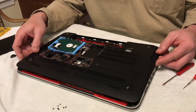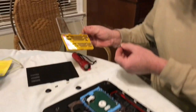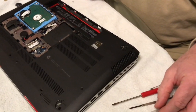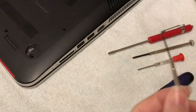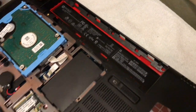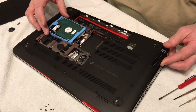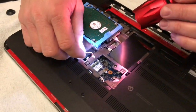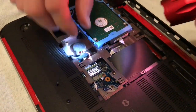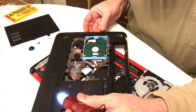We finally got this thing where it will separate. We had to go back to the hardware store and get a set of real small screwdrivers — like for eyeglasses — and ended up having to use one of the smallest straight blades to back out all the little screws around the battery. We finally got that loose. Now we're trying to see if we can move this thing without unplugging the hard drive ribbon. There was a little wire with a normal style connector — I got it unhooked with a pocket screwdriver. I'm going to try to twist this and leave the ribbon strip hooked up — and yep, there we go, we've accessed the fan.